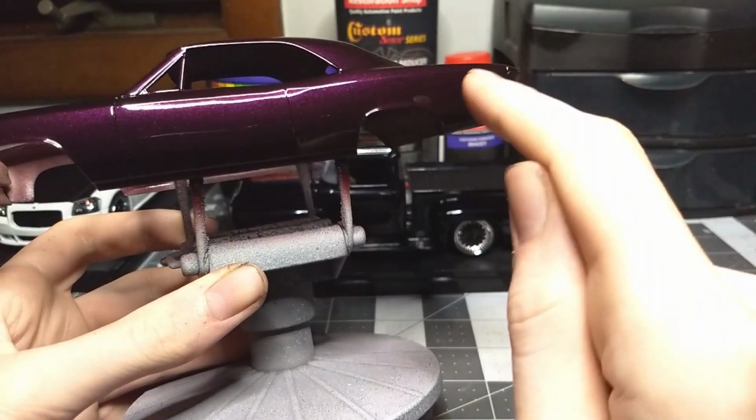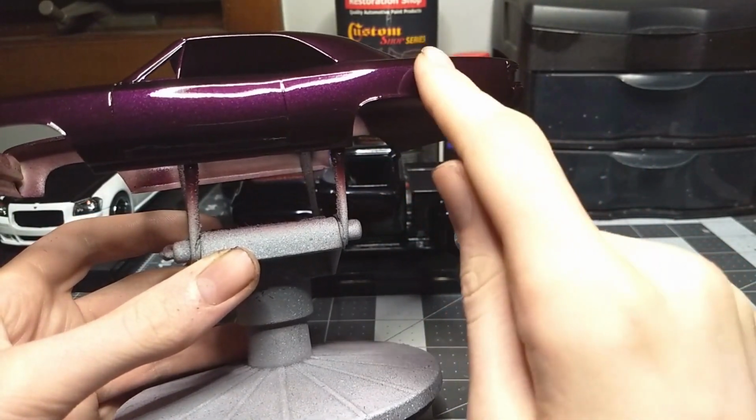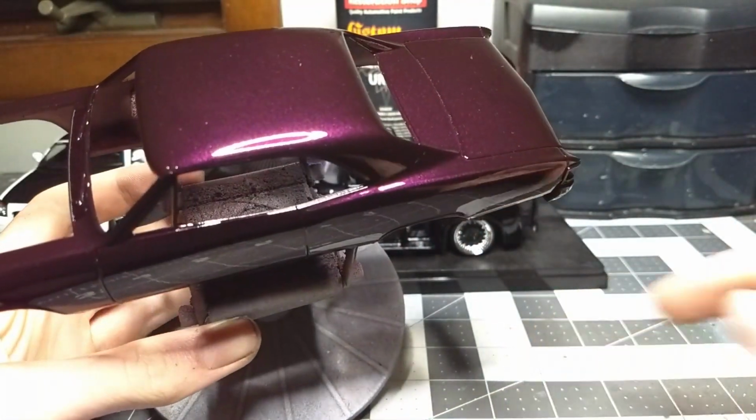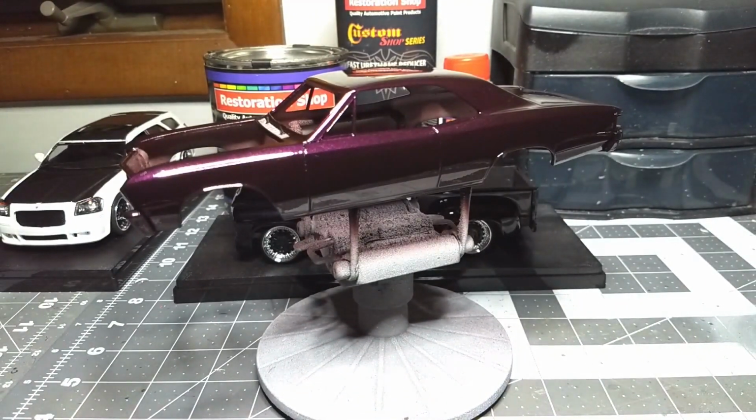Like I mentioned, if you're going to put a decal on, like I'm going to do on the Chevelle, you can put a decal on when the clear coat is still tacky. It's touch dry, like mine's touch dry, but obviously not dry enough. Because I cleared this around 6 o'clock my time, and it's midnight, so 6 to 7 hours is touch dry. You can do your decal work or whatever, but if you're going to clear it again, make sure you clear under the 12-hour mark.